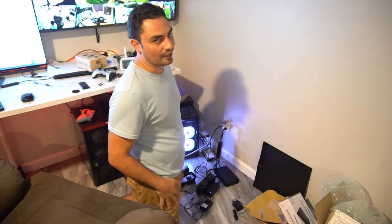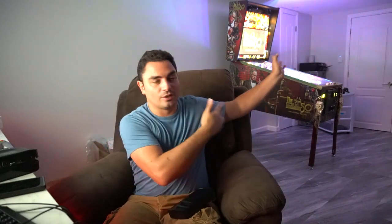That video was shot about five days ago. Basically, using the power cords that came with this system, they are two five-volt power bricks. I messaged the customer: 'Hey dude, I just noticed you have two five-volt bricks — the hard drive external needs a 12 volt.' He goes, 'Vic, that is what the company sent me.' So if that's true, this company sent you the wrong power supply — obviously not enough power to move this drive.